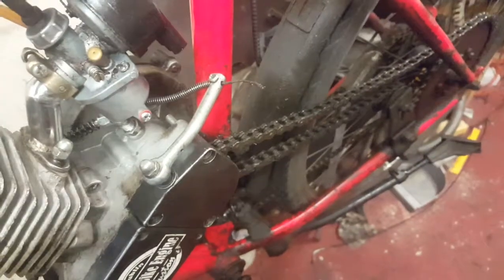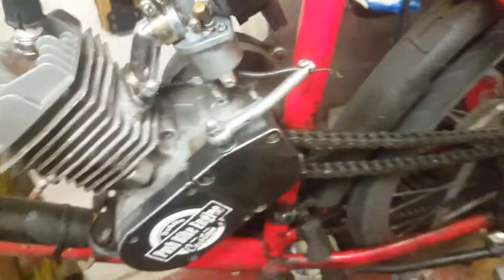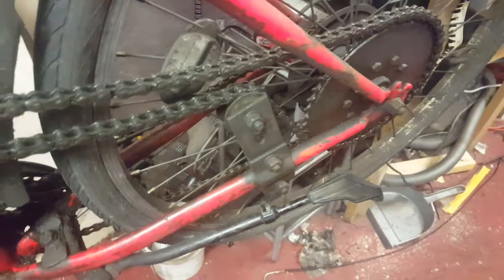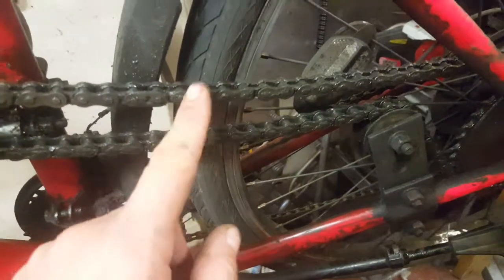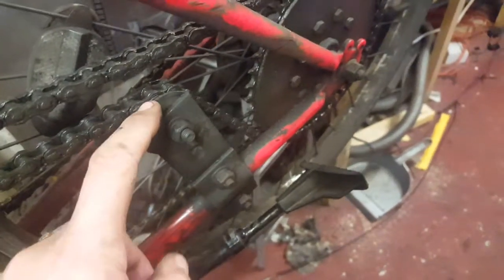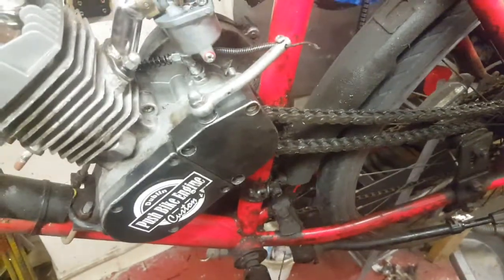That's it — it was simple, but you have to know what to look for. In this case it was the clutch pin. What I noticed next is that the chain is very loose. We'll need to cut the chain by maybe one to one-and-a-half links to make it shorter, and also fix the chain idler pulley — I think the pulley should sit at the bottom. But that's for the next video.